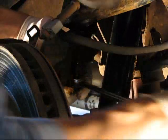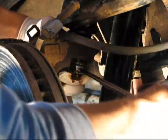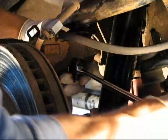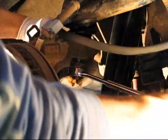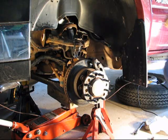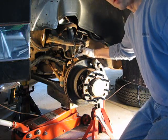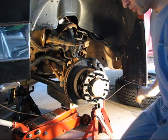I'm just getting some more close-up shots so you can see what it looks like. You don't want to remove this nut all the way — you want to leave it kind of on its last threads. You don't even need to break out your pickle fork to separate. As you can see here, we separated the upper control arm from the lower control arm assembly.